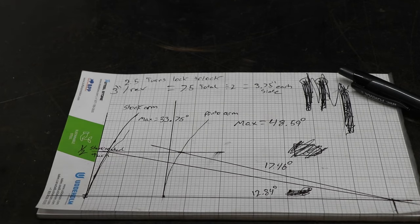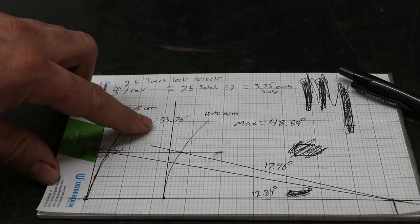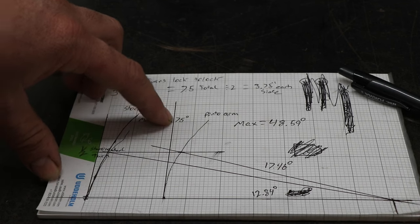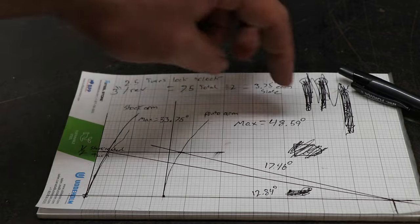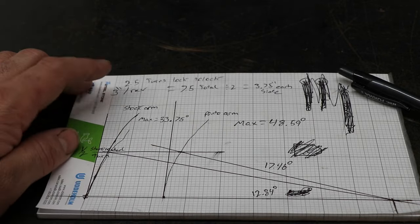And if you were deciding to try to take one of these cars drifting or something and it's about getting angle, this would be a real easy way to do it, where you're going to go from a max lock angle of 33.75 degrees to 48.59. That's probably still not as much as you want, but like I said, we're talking the stock 12:1 steering